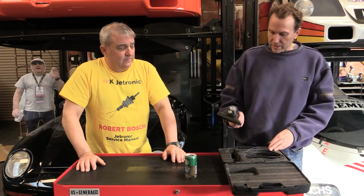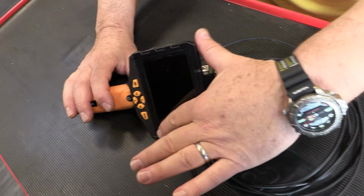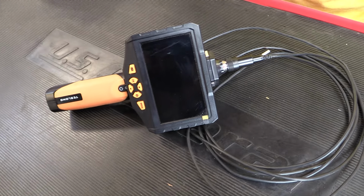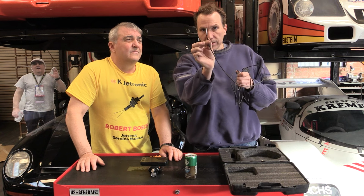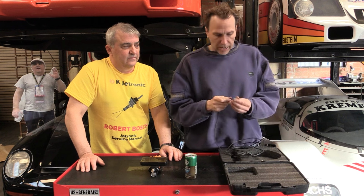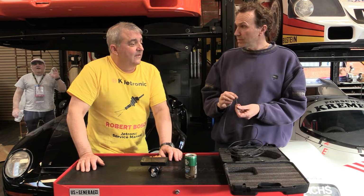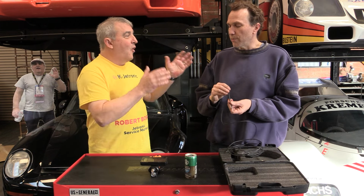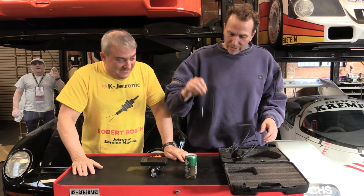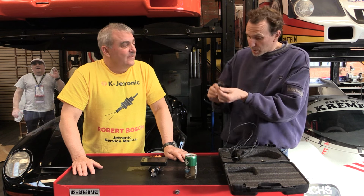And this is Buck Rogers technology again. This is a CCD camera, so even though it looks like it's a fiber optic thing, it's not. So there's a tiny, tiny, tiny camera. This is the size of an M6 through hole. So you can then drill. I had a fuel tank sender and it wasn't working, so I removed one bolt. There was no fuel in the tank. Okay. No fuel in the tank. I went down through the hole. This is deceptively much smaller than it looks.